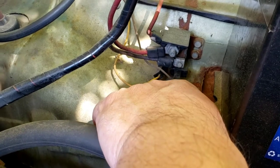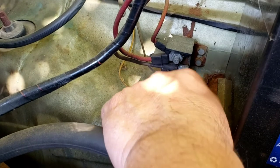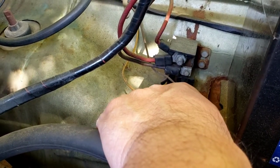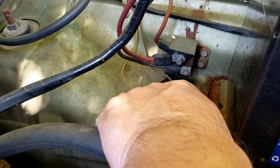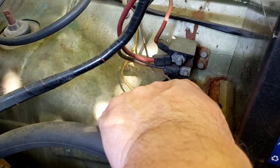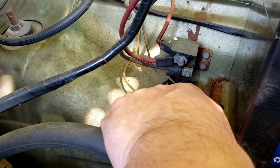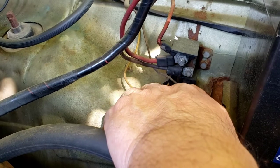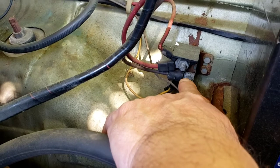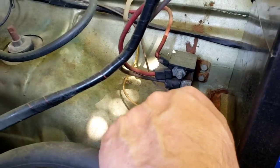When the yellow wire gets power and it sees the ground, it's going to make the connection from the positive to the solenoid and it's going to crank. This is for a car that does not crank at all. A lot of people get mixed up between 'my car doesn't start because it doesn't crank' versus 'it cranks but doesn't start because of ignition or fuel.' This is a dead car — totally does not crank, does nothing.